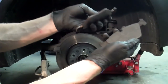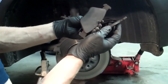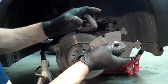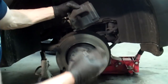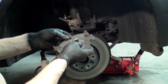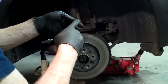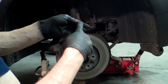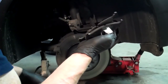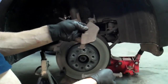Take a look at the pads from profile. These are almost down to the metal with very little pad material left. On a BMW you'll have a sensor that fits in here — the sensor is best put in at the very end through a window on the back side. Incidentally, the sensors can be rebuilt: take the old sensor out, you'll see two little copper wires, and if you put a bead of solder connecting the two, that solder will touch the ground and actually make the sensor last longer. The sensor is made of brake pad material with copper wires inside.